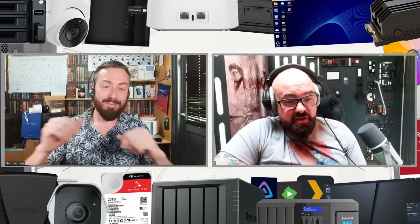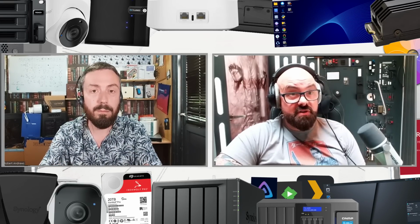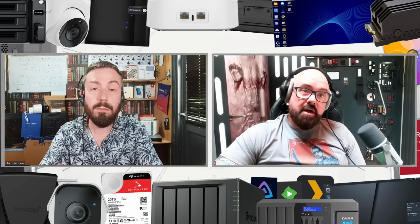But as well, it's not always an advantage, in my opinion, to have your warranty all with one company. Maybe Synology and the big brands of turnkey NAS have very good warranty, but I'm sure there are some less well-known brands that may have more questionable warranty. Say, for instance, the power supply in your NAS failed. You're going to have to send your whole NAS back, I would imagine, to have that replaced under warranty, and you're going to be without your NAS for a while.